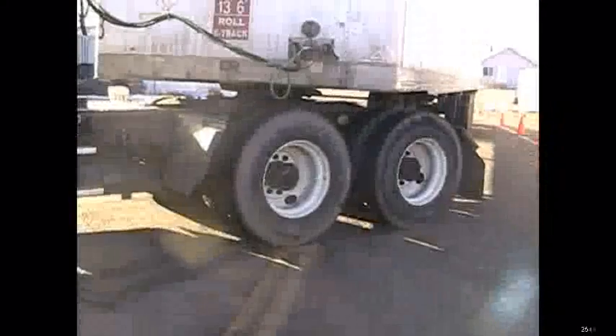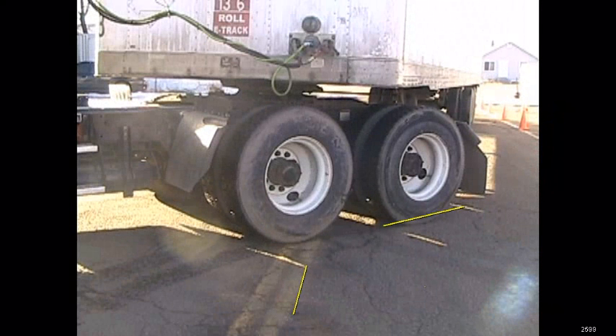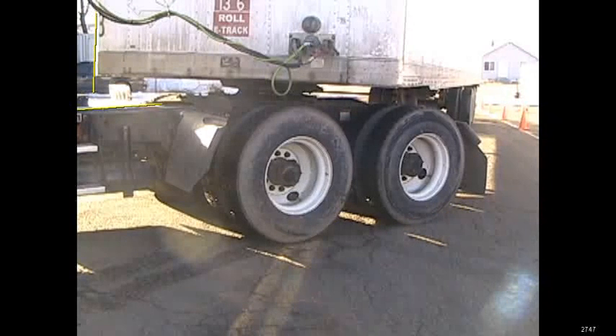We can use another reference point where we look at the lines here and see that the back trailer tire — a truck tire — is about a foot past that line. We can also look out the back window and use this trailer rail, the corner of the trailer right on our frame rail. That's another way we can tell when we've come far enough and know that we're going to turn it back to the right.